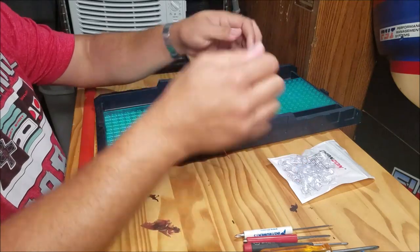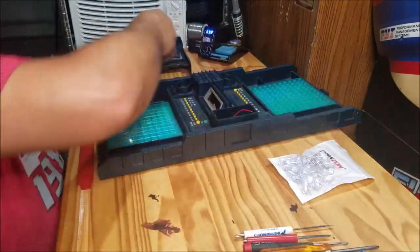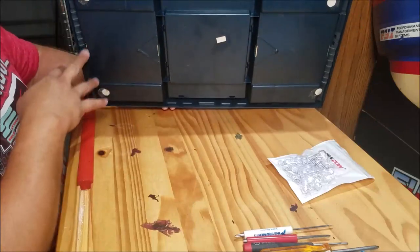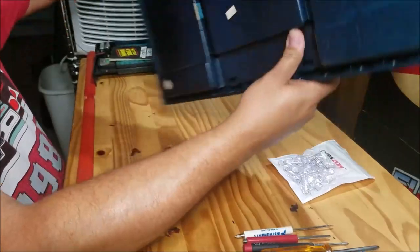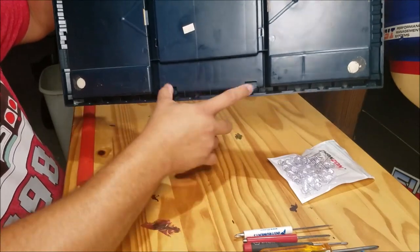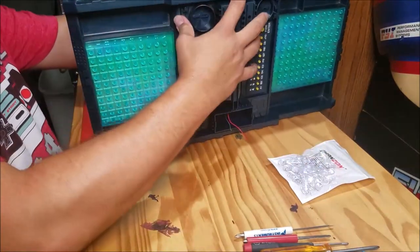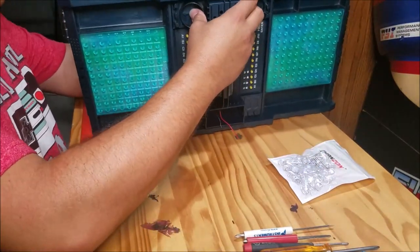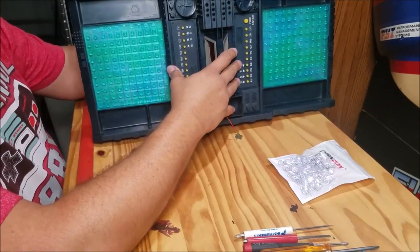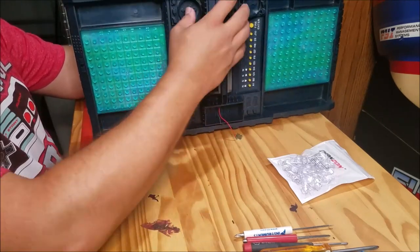So we're going to go ahead and remove the batteries, take those out, set them aside. We've got to open this guy up. We've got some tabs here on the sides, and then there are some long tabs here. I just have to push down on these tabs while pulling from the other side — the whole thing should pop up, if this is anything like the '82 version. The body is pretty much the same; they changed the color a little bit — it's a little more blue. The only thing that changed is where it used to have sliders, now it just has push buttons. There it is, that should do it.